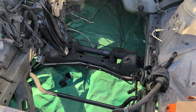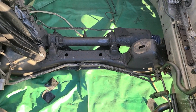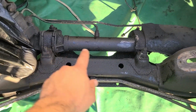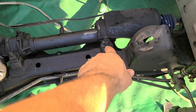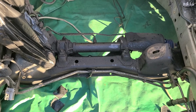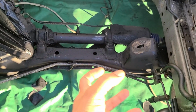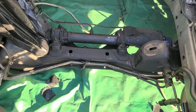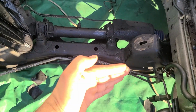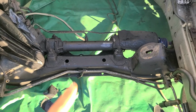And my other camera died, but anyways, what I was saying was, since I'm here, I'm going to order some steering rack bushings, which go here and underneath this one, and just replacing them for a little something newer, stiffer. It definitely helps with the rack. You don't want play in the rack. You don't want the rack going back and forth when you're driving or drifting, especially when you're drifting, because when you're drifting, you're putting a lot of angle and a lot of stress on the rack and it will blow out. So gonna be replacing those.